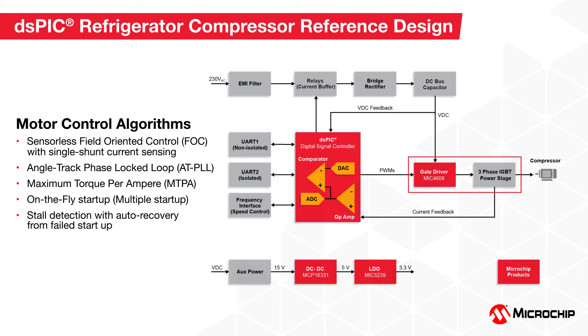The compressor control section features a 250-watt power stage and implements sensorless FOC control for a surface-mounted or interior permanent magnet synchronous motor. The variable speed control technique enables the compressor to function at its peak performance and conserves energy by modulating the speed of operation.